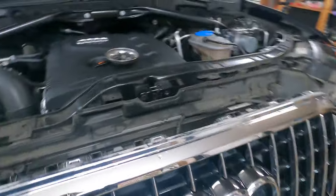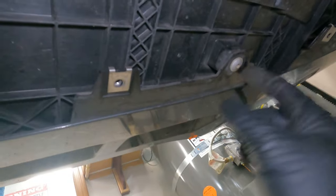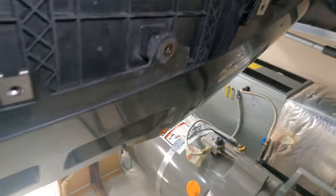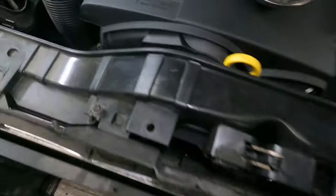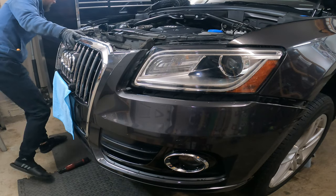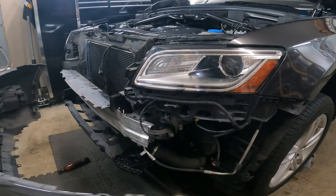Everything from the top is now disconnected. Here we are underneath the car. Now we're going to remove these bolts — if I remember correctly, they have a little shoulder on them, so remember to keep these separate. Just pop these guys out. Power tools all day long. See how those little bolts have a shoulder on them? That's where those go — the shouldered bolts. Now you can just grab her and slide her out.